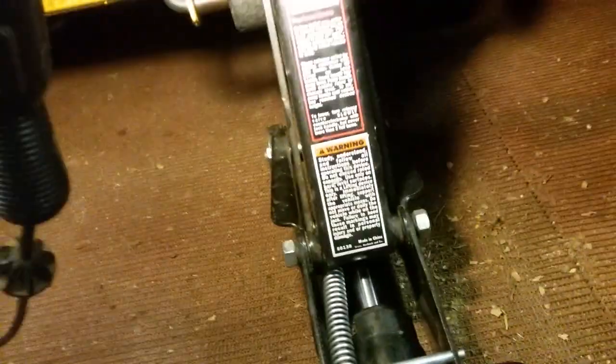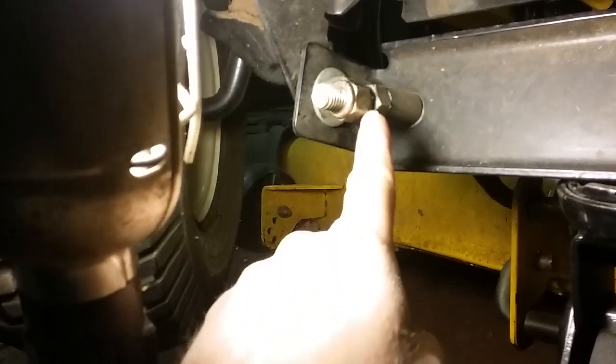Don't get under your lawnmower. I'm not going to put any jack stands under this one, but don't get under it. We're staying out from under it and showing you what we're doing right here. We've already tightened this one up some, but you take this nut and loosen it up just like this one. The magic number on this mower is an inch and three quarters. Well, you got this thing jacked up — turn your wheels just like that.